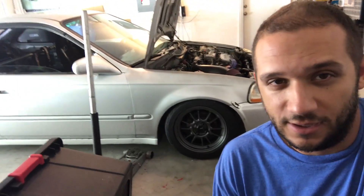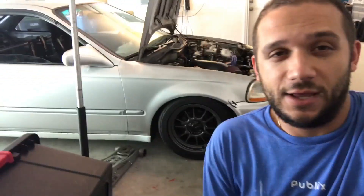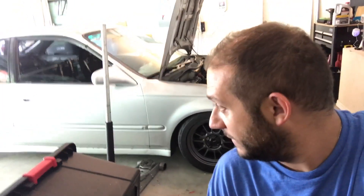That's giving me issues because I really want to run more camber in the rear — right now I'm probably zeroed out with no negative camber. The fronts seem to be pretty much set up — around two and a half to three degrees of negative camber in the front, which is pretty good. What happened when the ball joints were installed, which I didn't realize would happen, was the car in the front was lowered about half an inch. It's definitely higher in the rear, which I'm not sure I'm too concerned about yet.